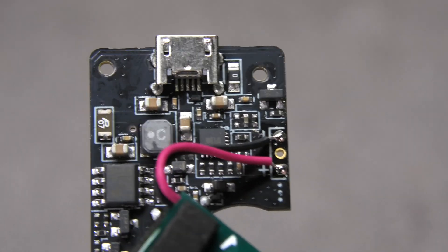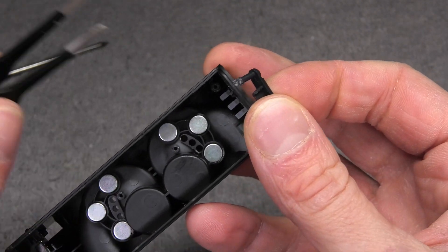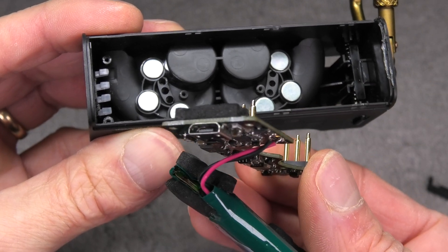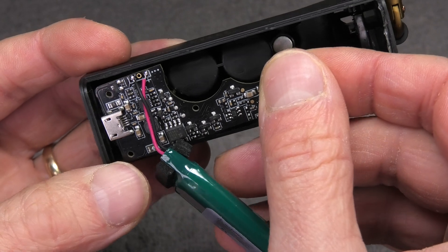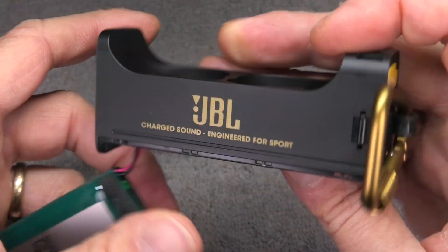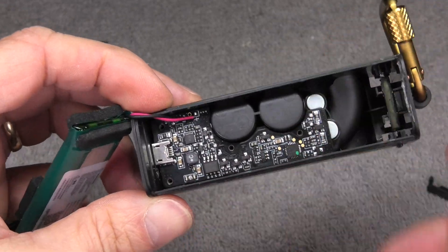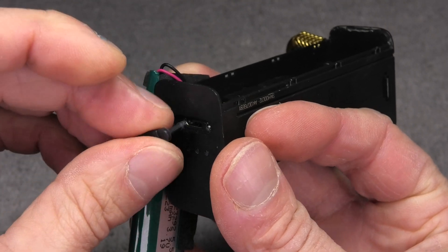For reassembly, I finally removed the dust cover rubber piece so it's not in the way when reinstalling the PCB - it's really difficult to get the board back in with it still in place, and I didn't want to accidentally damage the charging pins on the backside. So I carefully push the PCB back down, checking that all the pins are poking through correctly and the charging port is in the correct location, then add those four screws back - don't over-tighten them or you'll break the PCB.